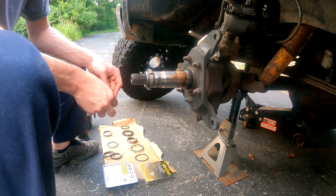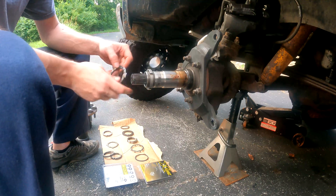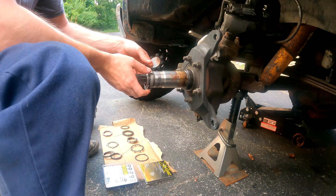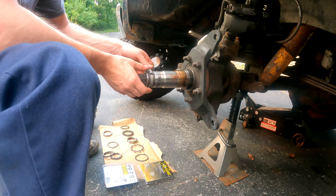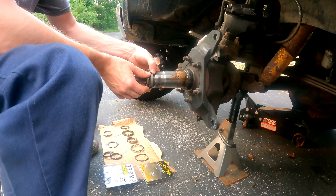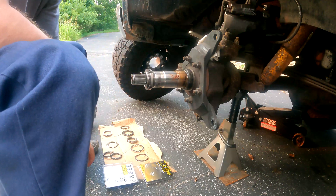With the pin out, you have a retaining washer that's keyed for your spindle — a keyway — and then a bunch of holes for that pin. You put that on next after you do your preload setup. Make sure the pin is actually in one of the holes; some guys make the mistake of not getting the pin in the hole, go to put on the next nut, and it just crushes and breaks the pin off. A lot of guys will back it up just a little rather than have the bearings too tight and burn them up.